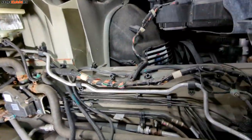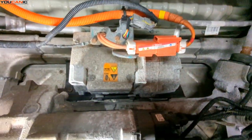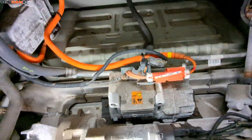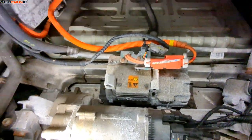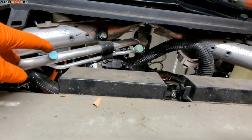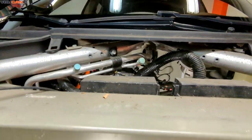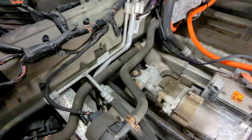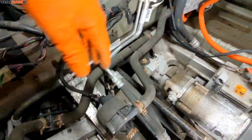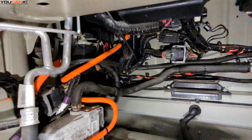You can fill it from up top. Right here is your AC compressor and that is high voltage — anything with the orange wire is high voltage. Then your AC cooling lines and your high and low fill for the AC. There are some more pumps and units here, all able to move fluid where it needs to go to cool the different components on your vehicle.